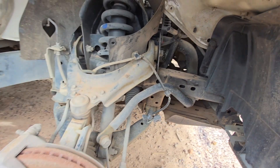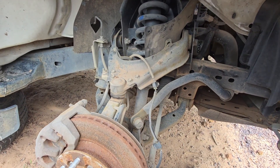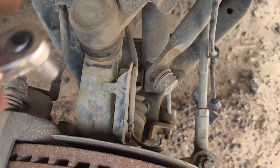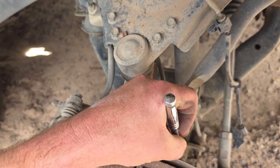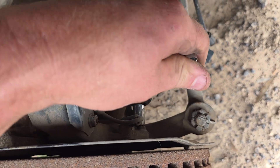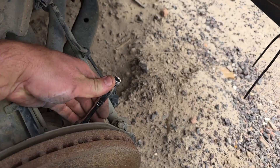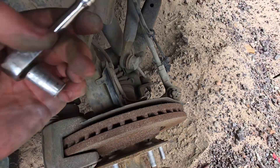So see I unplugged it like that. You've now got the same thing through here — you want to grab it, give a bit of a squeeze, and then pop it through. You've got all these parts on the new Parts Factory one. You've got this 12 mil, this 10 mil here, and 10 mil down there — and it should be off. So I've got a ratchet with a 10 mil on it and I'm just going to lefty-loosey — put it in the function where it's going to come towards you. Then the same one down here. Once you've cracked it, you can then just undo it by hand most of the time. If not, get your tool back out and finish it off.